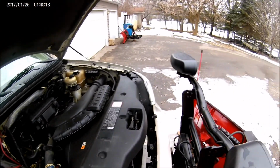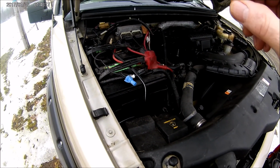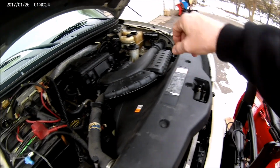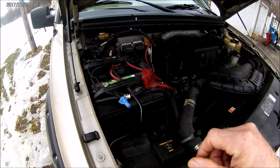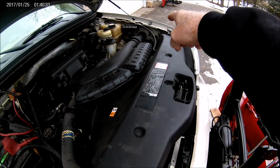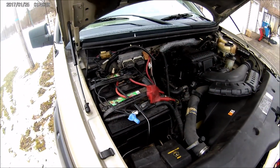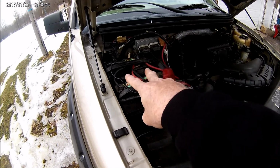My other truck, which is in the garage, it's a Chevy '02 Silverado, and it had a spot over here from the factory for a second battery. And it has the other one over there. So that one was easy. Just when I bought it, the second battery was already in it. But this is how I did it. You could put a battery over here and have the other one over there, like a Chevrolet. You just have to run a long hot and a long ground to go hot to hot, ground to ground. And then you'd have to extend your plow wires over to here.